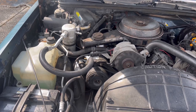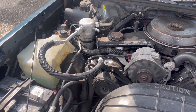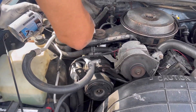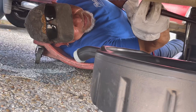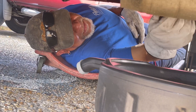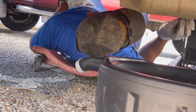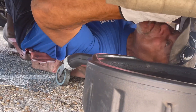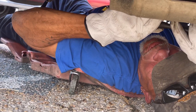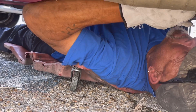The first freon can went off so we had to put another one in. Red's already taking care of it. We're going to change the screen and the transmission gasket, and see if the mount backed out. Red said it looked like it had backed out. The AC is blowing now — we didn't see any leaks, but if it were to leak out I just changed the compressor so it's no big deal. Stay tuned.